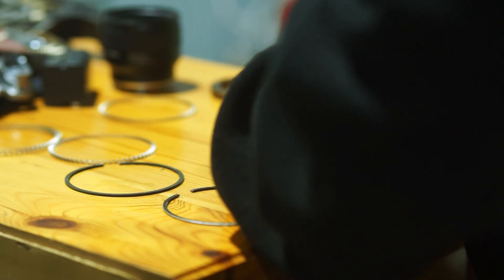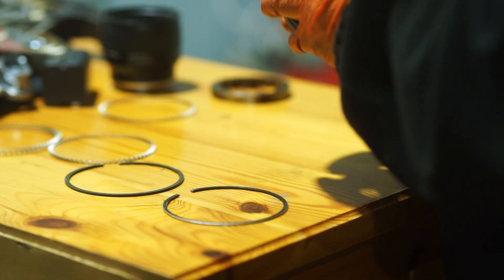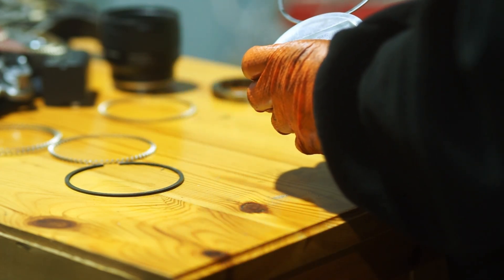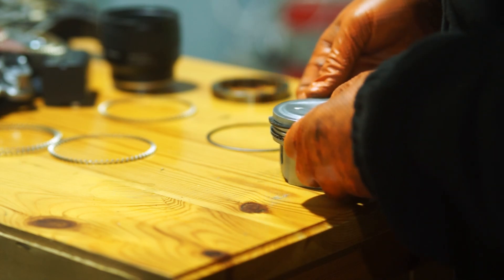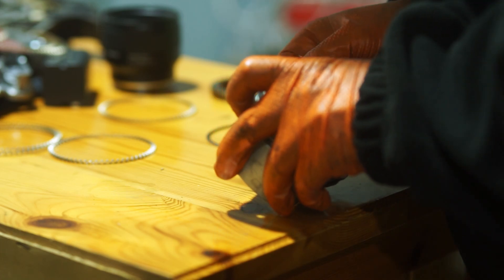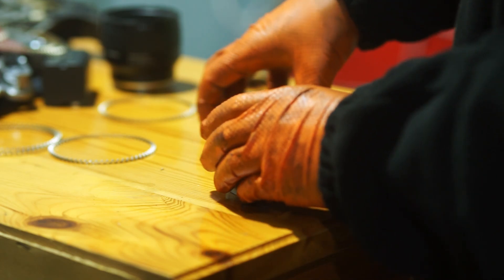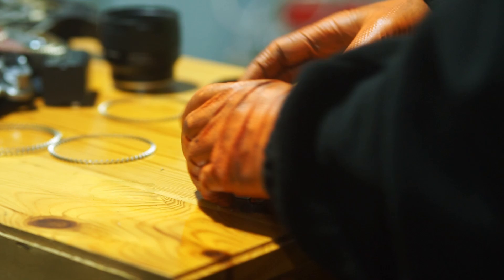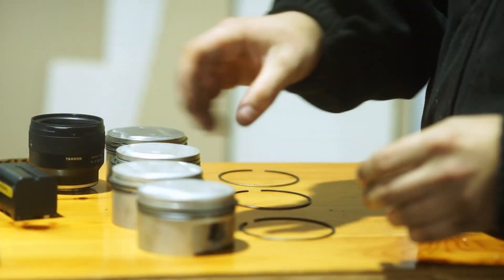After that you just put on both of the compression rings. Be careful though — some compression rings depending on the manufacturer have a top and a bottom side. Some have a chamfered edge which can go on the bottom or top, so look that up in the instructions that came with your rings. I bend them outwards as little as I possibly can so I don't accidentally snap one. You may snap one or two if you are doing this for the first time — don't worry, it happened to me in my first few engines too.